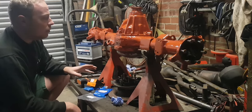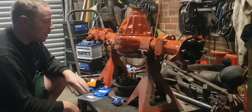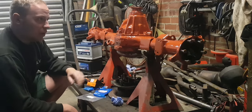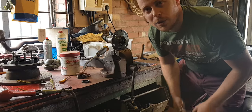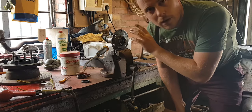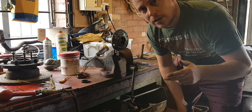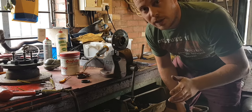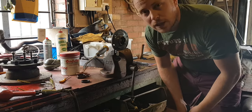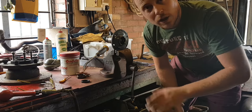We've had two coats of red oxide now, and while that paint's drying I'm going to strip down the hubs — I've got a bit of cleaning and painting to do on them. Replace all the wheel bearings, all the gaskets and seals, before putting them back onto the axle. So while the axle's drying I'm going to work on the hubs and the stubs. I'm going to replace all the gaskets and seals, replace the discs, the calipers — everything. This axle's getting a total refurbishment. The only thing I'm not going to touch is the diff because there's hardly any play in the drive shaft flange, it wasn't noisy, so I'm just going to replace the oil and go from there.